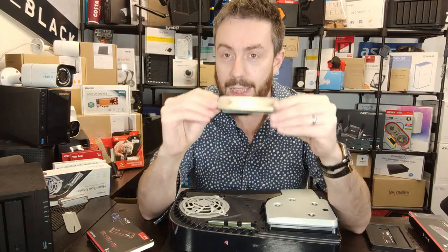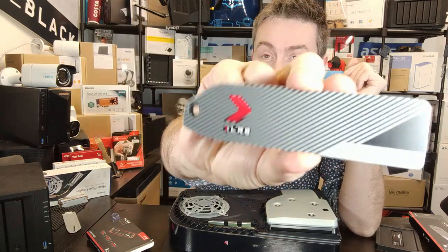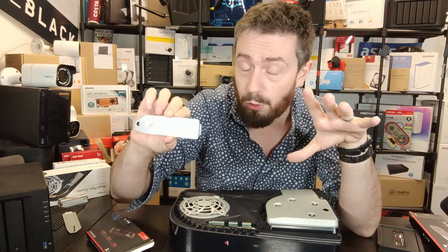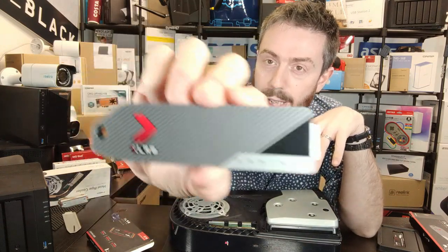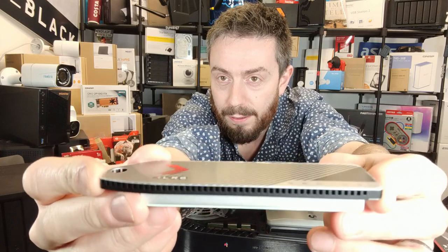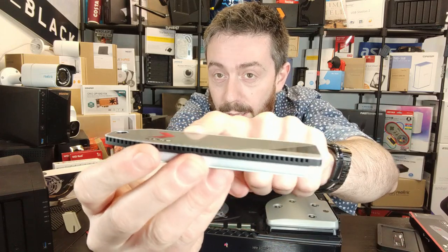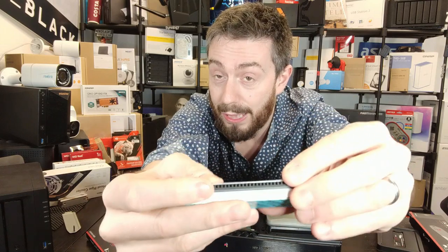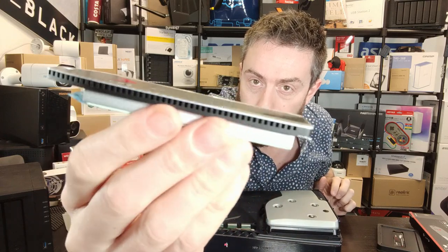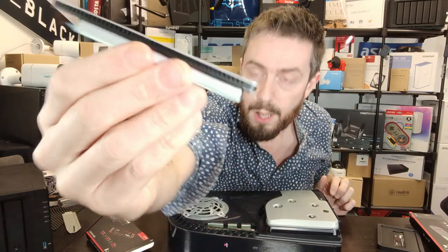Now, the first thing that hit me when I saw this heatsink was, although I absolutely love the top of it, because that is a nice looking heatsink, let's get that really close to camera. There should be an article linked on NAS Compares in the description. It's going to have a lot more photography of this item. The first thing that really surprised me is that top bit isn't actually three-dimensional. If we bring it nice and close, it's actually a plate there at the top. There's a layer of plastic that I will be removing during the installation, but as you can see, it's actually a metal heat dissipation plate. It's not plastic, that is metal there on the top, but it doesn't reveal the ridges. The ridges there are a selection of holes at a vent angle. If I bring it around real slowly, hopefully you'll see there that they are transparent all the way through for air to pass through.